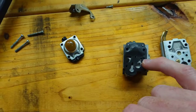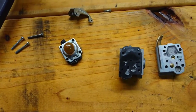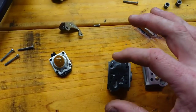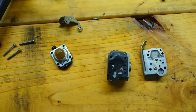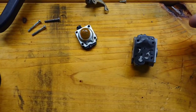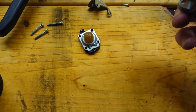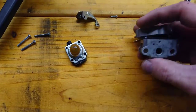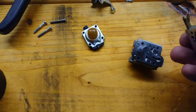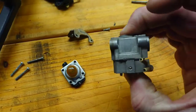And you'll see these are what they call the reed valves just on the sides here. I'll just point them out. That there and that there, and basically they act as flapper valves that allow the fuel in and out as they go through various circuits. And so to assemble that part, I can then put that on top there, and that is all quite fiddly doing it one-handed. I'll have to get a head cam at some point. But yeah, essentially that just goes straight on the top there, and you can see that's sort of sandwiched in.